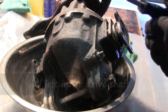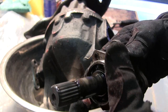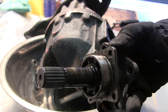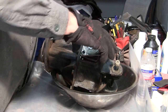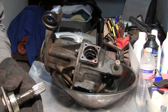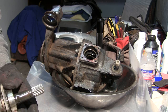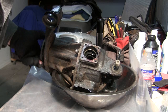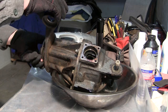It's not sloppy — it's a very good fit. A little bit of a rumble there, not a smooth action like a new bearing. It's not the clunk clunk that I was feeling before. This one had more clunk and I can feel clunk clunk clunk in here — that's the right side. It fit very, very well, it was not sloppy. That's definitely got problems. There is some clunk in here. Feels like whoosh, boardy, gravelly. Propeller shaft pinion to crown wheel action feels smooth. Pinion bearing and carrier bearings feel smooth. No preload requires a deeper investigation, adjusting the backlash and reshimming.